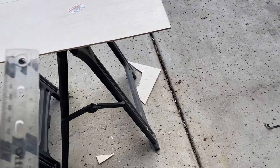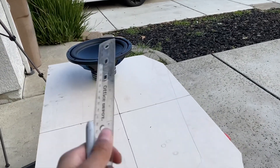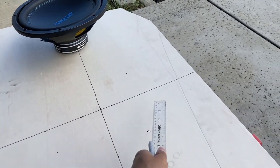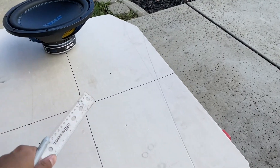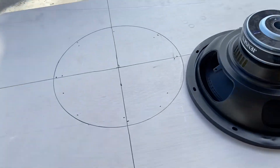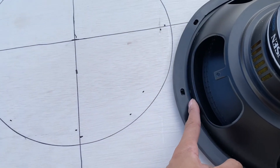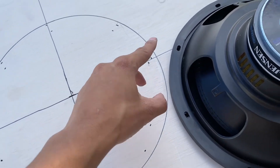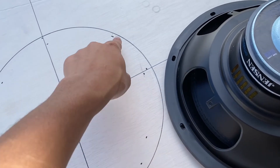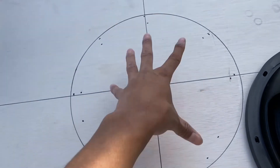The board is two feet by four feet, so I found the center point. Since it's a 12-inch sub, half of 12 is 6, so I measured six inches from dead center out to each of four points, then did the same in the center of each square to mock up a circle. I'll flip the sub over, mark a circle around it, and cut it out. I also measured from the center of the sub to the edge so I can countersink it — meaning I cut a slightly larger outer ring to leave room to drill mounting screws into the wood. If you just cut the big hole without countersinking, the sub falls straight through.